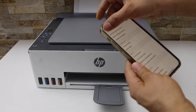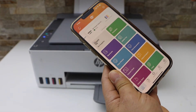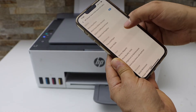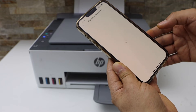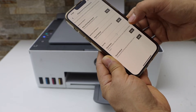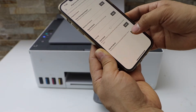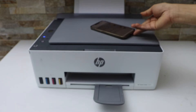Go to the HP Smart app. In the app section you will see your Smart Tank printer — select it. Go to the Tools section and click on Alignment and Maintenance. Under the Cleanup section, the last option is Clean Print Heads. Click on it and it will start the print head cleaning. It will also print a diagnostic page at the end.